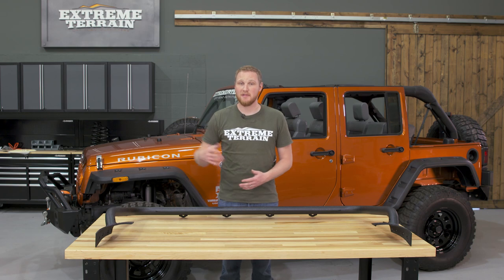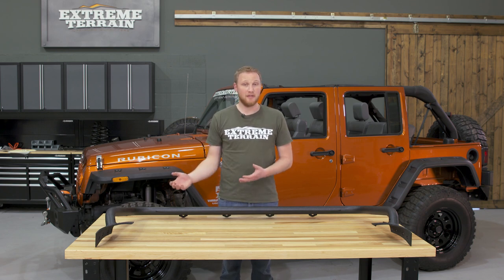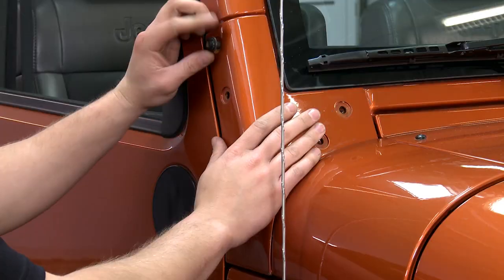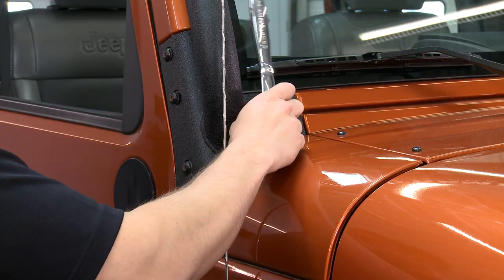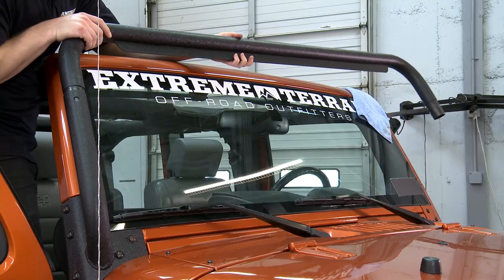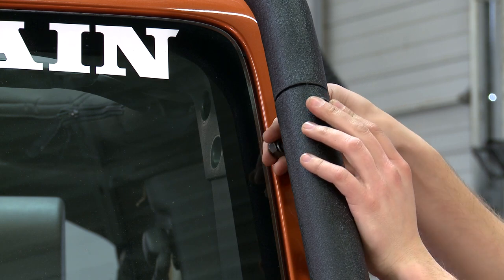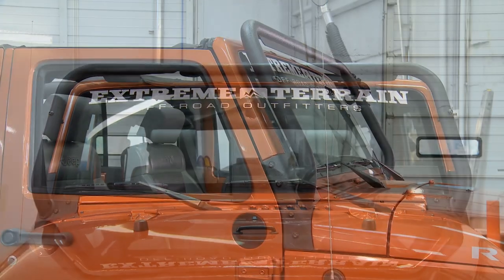A lot of light bars of this style are designed to be completely bolt-on, and this one is no different. The installation process is pretty simple. If you follow the instructions, they recommend that you put some tape around the windshield hinge area because the brackets can be a little bit cumbersome to work with, and you don't want to scratch your factory paint. The first step is to remove the six windshield hinge bolts. Once you have those removed, you can lay the bracket over top and reinstall the factory bolts — leave those a little loose for now. From there, you can install the crossbar and work your way around to the other side of the Jeep, installing the last windshield hinge bar. Once everything is installed, you can tighten up all of the bolts, including the ones that hold the crossbar to the individual bars on either side. After that, it's just a matter of installing your lights.